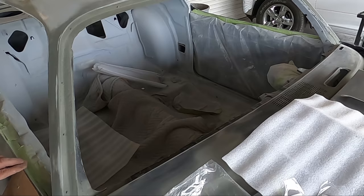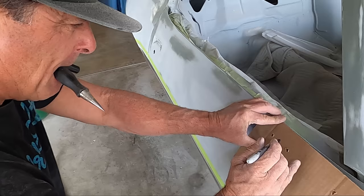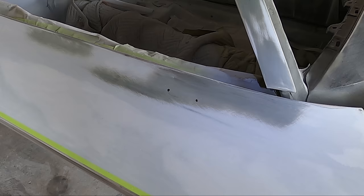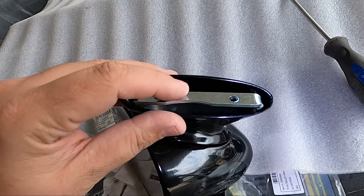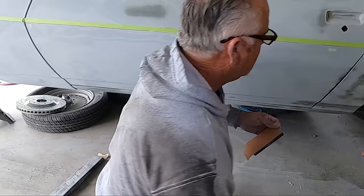Now we're creating the template because the driver's side only had the mirror hole and the passenger side didn't. You can see where I attempted to make a template and Heath looked at me and said 'no Matt, all wrong, your eyes are about a quarter inch off.' So we made a proper piece of cardboard that wraps around — touching the front at the front of the line — and we got our two holes. In this instance the driver's side has that big long wire that hooks up to the door so you can adjust the mirror. The passenger side doesn't have that, so you only need the two mounting holes, which should line up with the holes in the bracket. It's pretty dang close — now we gotta drill it out, that's going to be the scary part, messing up Craig's perfect sanding.